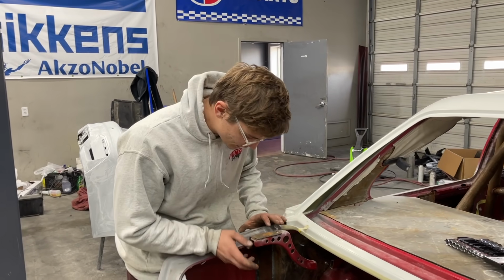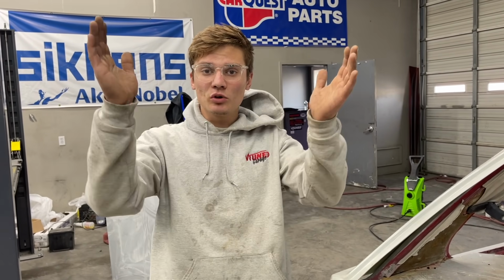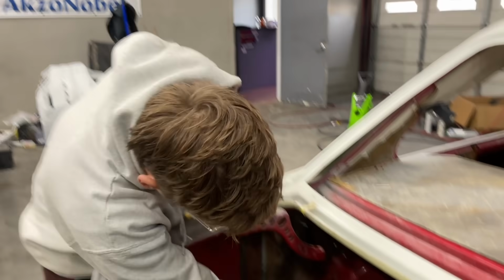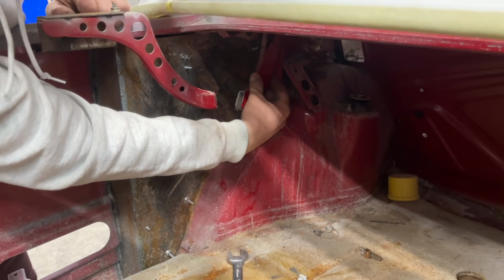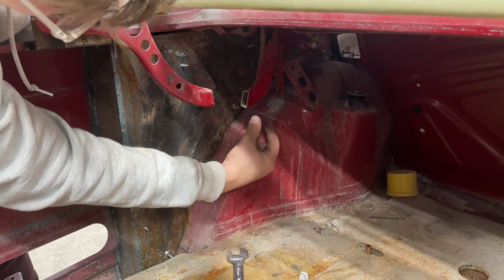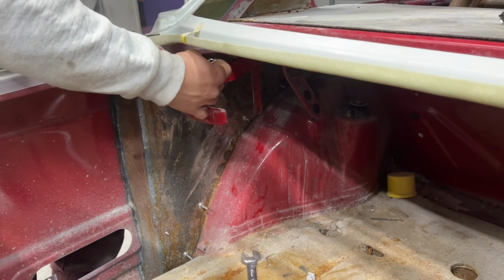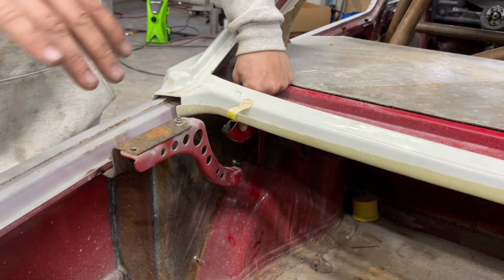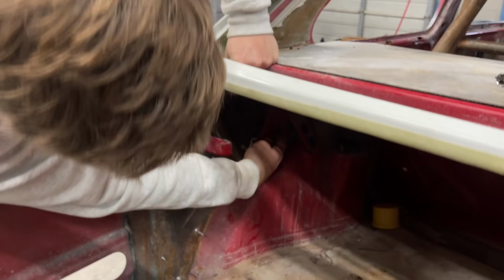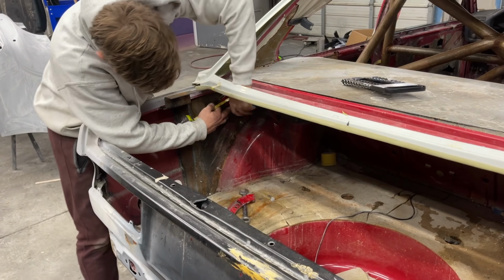Here's our setup. As you can see, the hinges just bolt on here and we have our trunk spot. But the E30 M3 has more of a V-shaped hinge, and this one's a U, as you can see right here. So we're gonna need to cut this one right here and make this hinge go down lower and come out like this. That way, as you can see, it won't clear. So we need to measure from the end of this to here to see exactly how much we need to add onto this hinge. And we'll go to the steel store and get the necessary steel and remake this hinge.